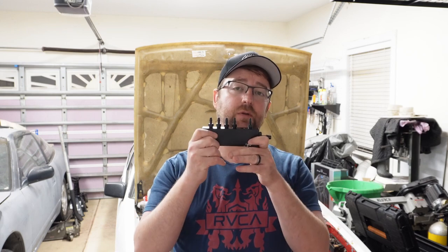With ITBs it's a little different, because typically your ECU looks at two axes — your RPM and your manifold absolute pressure — to determine things like how much fuel and what kind of ignition timing, among other factors. But with ITBs, because you don't actually have an intake manifold, you can't really have a reliable MAP sensor except in certain conditions. That's where having something like this comes into play — you can have a MAP input to your ECU for these special circumstances to add an extra factor to the tuning to make it run better in different situations.